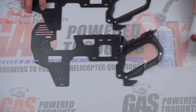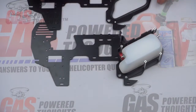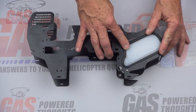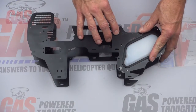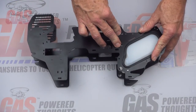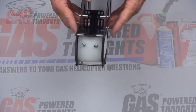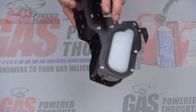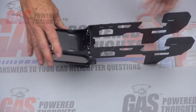Here we want to put the two frame halves together. Start by taking the fuel tank from the pre-assembly and set it into place just below the battery tray — make sure it's square to the frames. Take the remaining frame half and set it on top; the tank is captured by the isolators in the frames. Use the bolts that came with the conversion: 8-millimeter in these four positions, 12-millimeter here, using finishing washers. Make sure you leave the two on this side and the other side loose because we're going to need to spread the frames to get the upper plate in place in the next step. At this point you'll see the fuel tank is between the frames with the pinion guard in place — the front bolts can all be tightened and threadlocked, but the back is handled by the upper chassis.